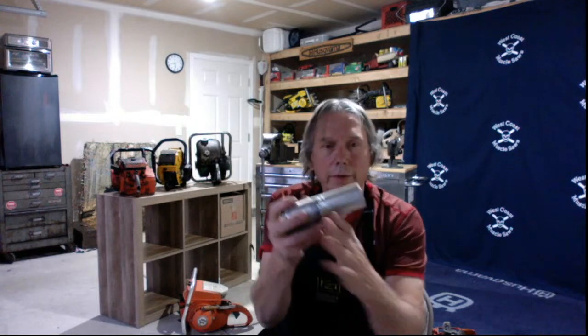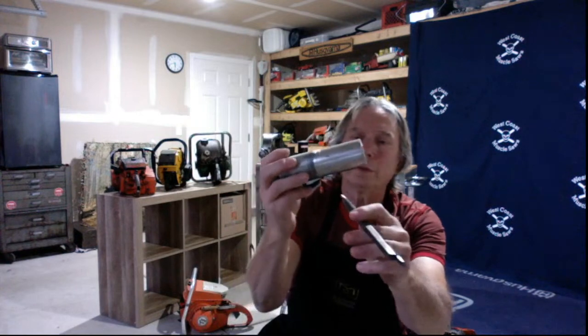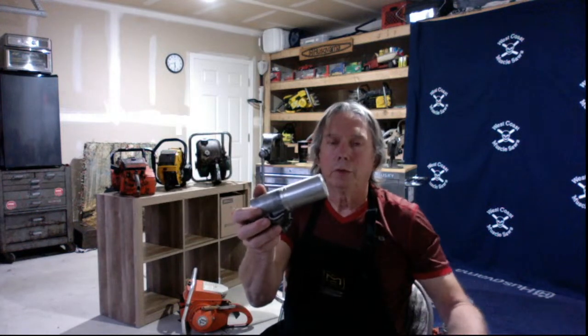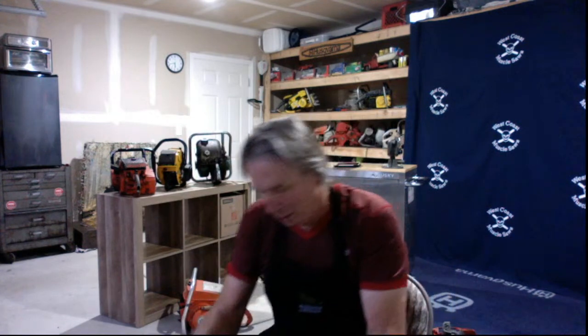and he builds the mandrels, slides up in the cylinder, got his lathe here, grip down on it, got the deadhead over here, and then he turns that, and he uses his lathe tool, and he reaches in there, and it's very delicate work. You've got to really be good at this. And he reaches in there, and he shaves that. He's got his measuring calipers down below, so he knows exactly what he takes off.